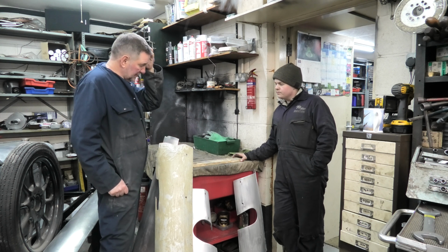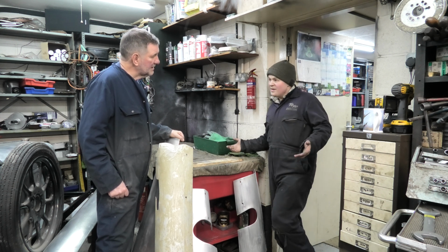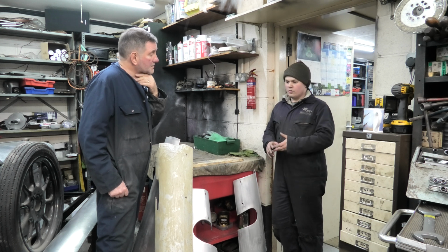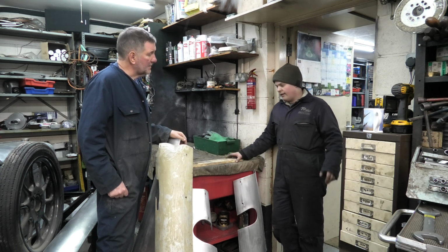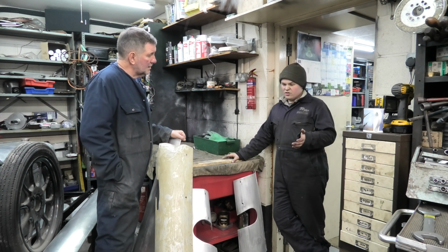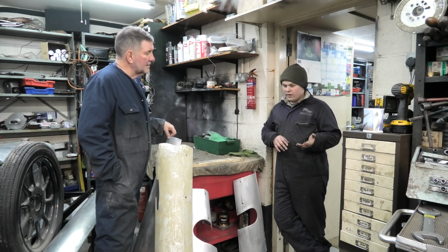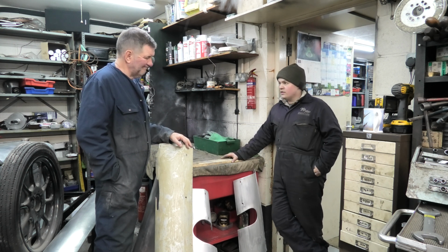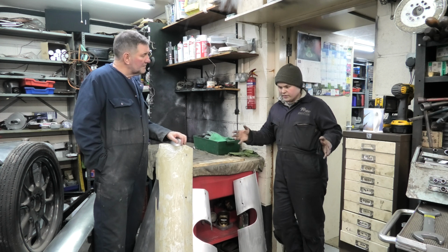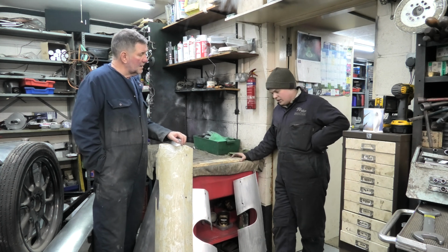So you've been making a jig in your workshop near home. Yeah, with a job like this, 90% of the work is making jigs, tooling up and stuff like that. So I've made a jig for the chassis, a jig for what I call the chassis bridge across the front, which is your wishbone top and bottom mount, carries your steering rack, which is the bulk of the chassis really. And that's had a little tweak on the right hand corner. Initially I thought I'd just straighten it out, but once you strip the paint off and look at it, there's a lot of previous damage on there. There are some poor previous repairs, a racing car with 70 years worth of history. So I bit the bullet, made a jig to make a new chassis bridge. I'll graft the new chassis bridge onto the old chassis, so we've still got the original chassis, but I've made a jig to straighten the chassis up.